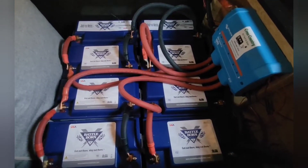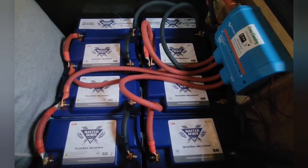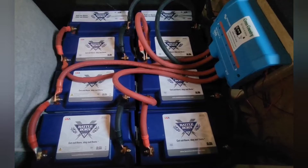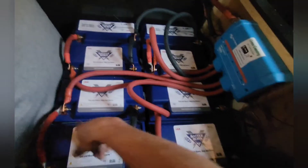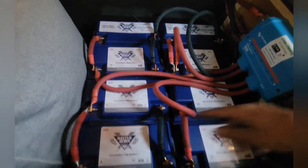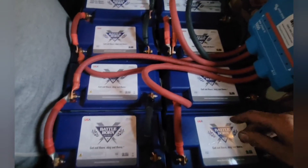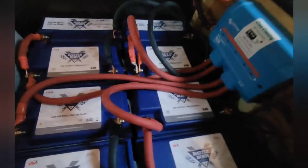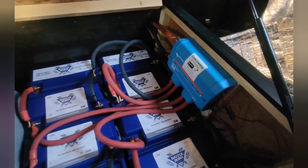Your batteries all stay equal. You just hook these eight batteries diagonally — over time, the ones in the center may not charge or discharge fully like the outer ones will. So you still want to come off opposite ends. You can see the positive coming off here and the negative over here going into the power in. Coming out of the power in, I didn't have to change anything — these are the same lines I had before. This is a good way to go.